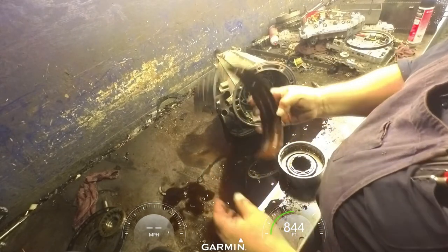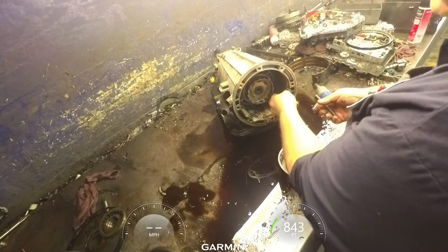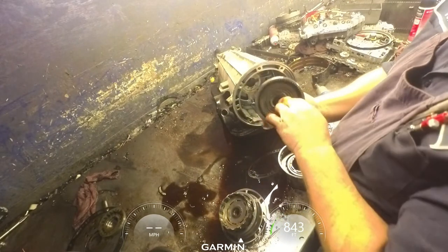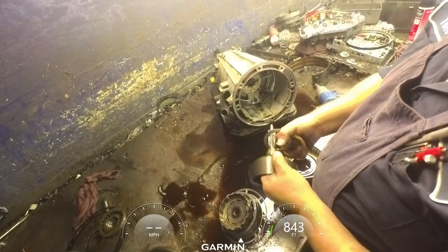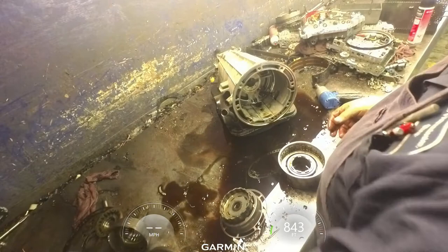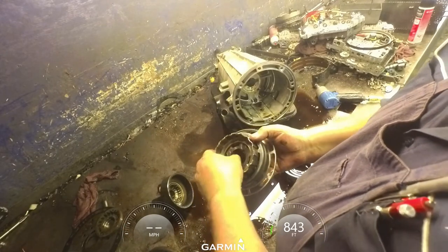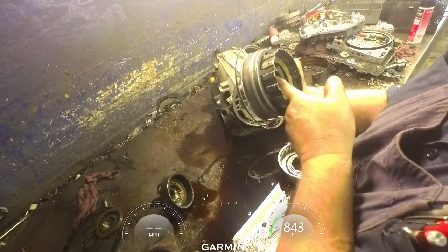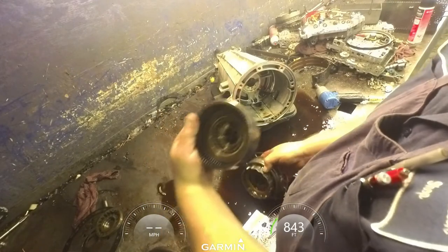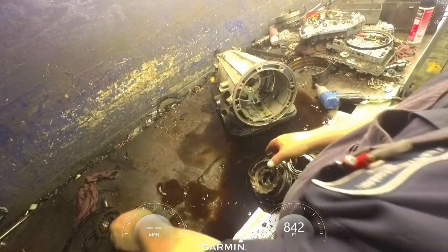Our overdrive band - even if this band looks good, replace it. They always break. Our band struts. Our overdrive sprag is bad because there's an oil slinger for it. It may still be holding but it needs to be replaced. Be very careful that you don't bend this ring right here. A lot of times there's brass washers underneath here and that one's gone. Most of the time it's missing at least one or two and it gets wrapped up inside here. We can just dig that out and this ring gear will still be okay.